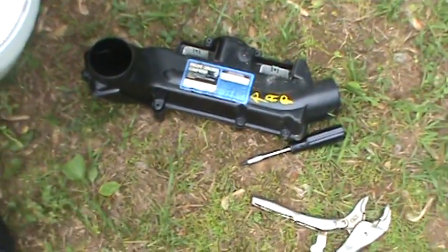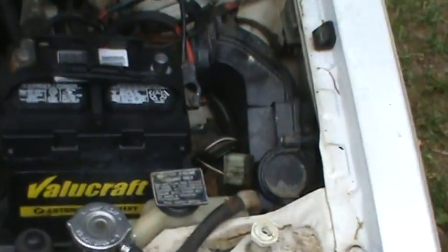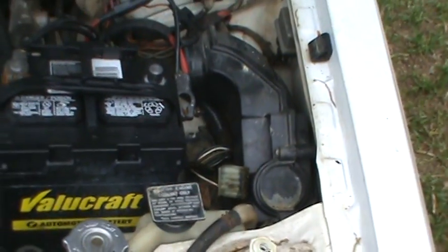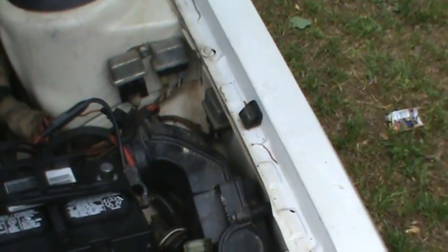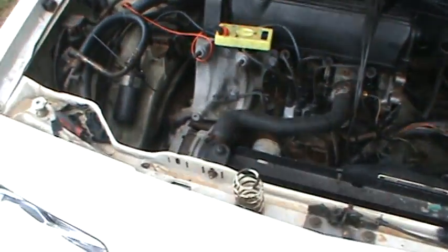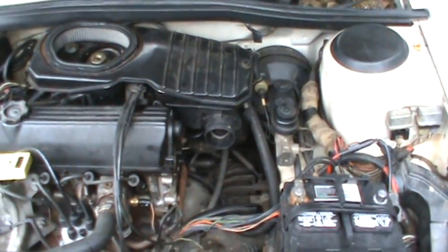And so I swapped the injector out, and then I also swapped out this computer temporarily, which goes right here. It's actually part of the airstream on these cars. It's got that duct that goes to the air cleaner. It keeps it cool because it's got some transistors and things in it. So I did all that. It wasn't too hard, but I got it done, and it didn't run any better at all. Same stuff. Power loss light on, just loping, and it just doesn't sound good. So I decided to get serious about this thing and just dig into it and find out what's going on with it once and for all.